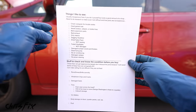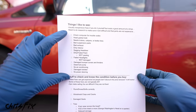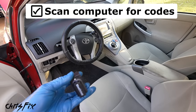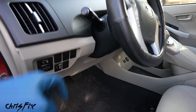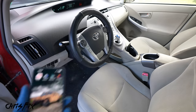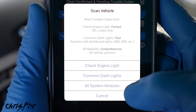Now this is a list I've come up with over the years from buying cars and fixing them up, and it's helped me tremendously. Normally you'd use this list before you go and buy the car, but in this case I'm going to show you the process with the car I just got. Up here are all things I like to see in a car I'm buying, and down here are things I like to try to avoid. The first thing I like to do is scan the computer and see what trouble codes there are. All you have to do is grab an OBD2 scanner — in this case I'm using a Bluetooth one. It plugs in right underneath the dashboard, and with your foot off the brake, just hit the ignition switch twice. Then get your phone or tablet, open up the app, and read the codes. We could scan for simple check engine lights, or scan for dash lights like transmission, airbag, and ABS codes — or we could run a full system scan, which is exactly what we're going to do.